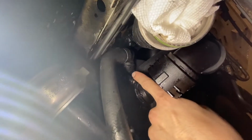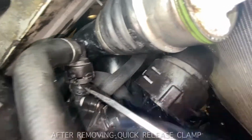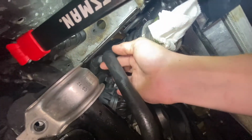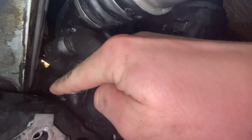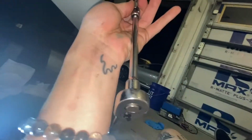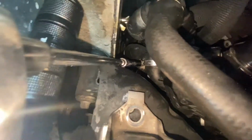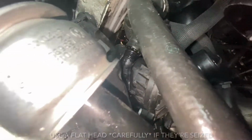I think now we're going to attack this. So I was just able to pop this hose connector free by coming in through here and prying it off like that. And surprisingly, nothing really came out. So now that's off. Now hopefully we can get to that hose clamp. Going to be using a 6mm socket with a universal ball joint, which can sneak right up through here and get on there. I was able to sneak this up there, put it on, and then attach the rest of the ratchet, and we're loosening it. Okay, that one took a while, but with some patience, we got it.